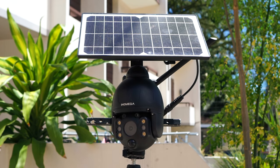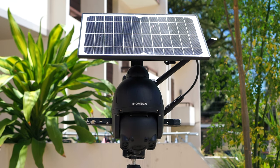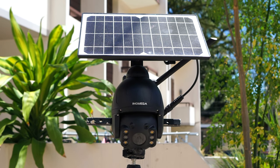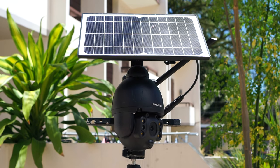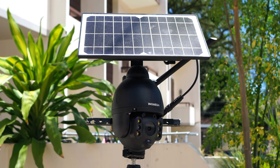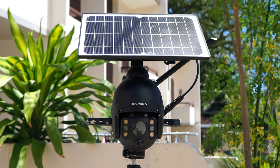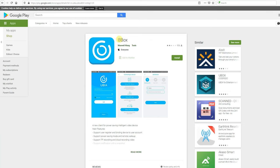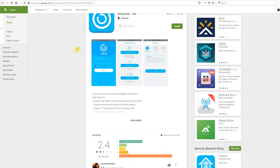The camera uses a 2 megapixel sensor that records 1080p at 20 frames per second. It can pan 355 degrees and tilt 110 degrees, and it comes with a 3.6 millimeter lens. It doesn't support preset points so you have to manually use the PTZ controls in the app when you want to move the camera. This camera is made to be used with an app called Ubox, and you can't access the camera through a web browser and it doesn't support ONVIF.